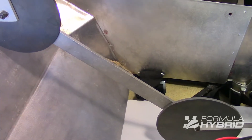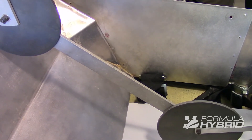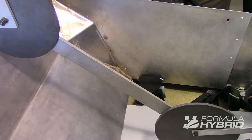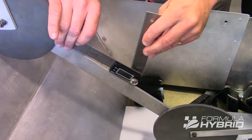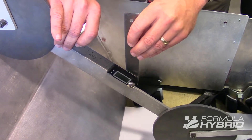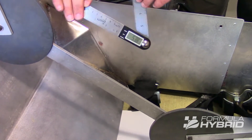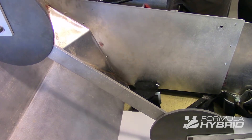While PERCY is in his driving position, one of the things we do is we check to see whether the driver is in a reclined position or not. The reclined position is based off of PERCY and not off of your drivers. In this case, we look at the angle of PERCY relative to the vertical, and in this case PERCY is approximately 50 degrees. At more than 30 degrees, PERCY is in a reclined driving position.